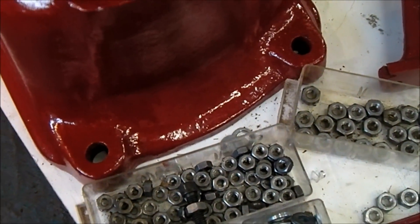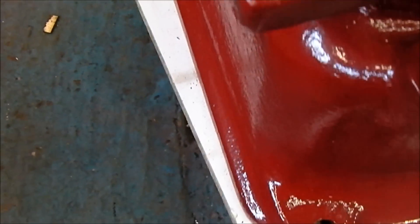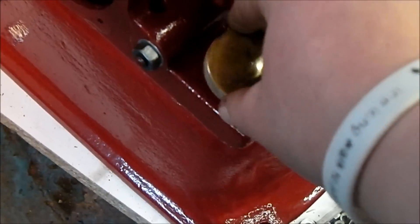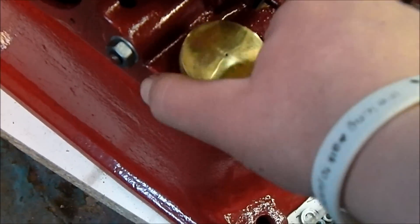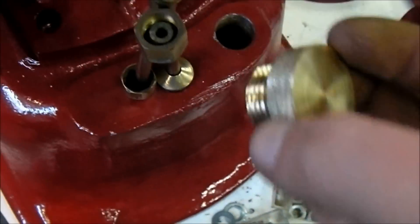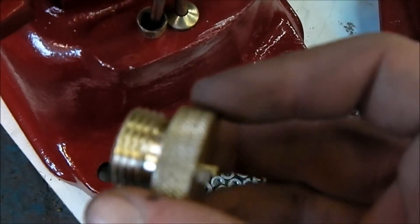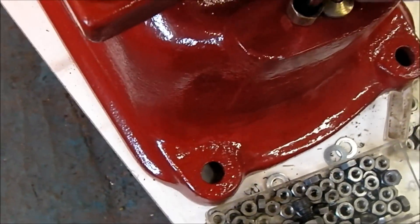I made these oil well caps. If anybody is wondering, these threads in here are 14 teeth per inch, so they fit quite well. I also just finished making a fuel tank cap — I made that last night. It's not quite finished; I still have to get some bits ground off it. That is also 14 teeth per inch threads.